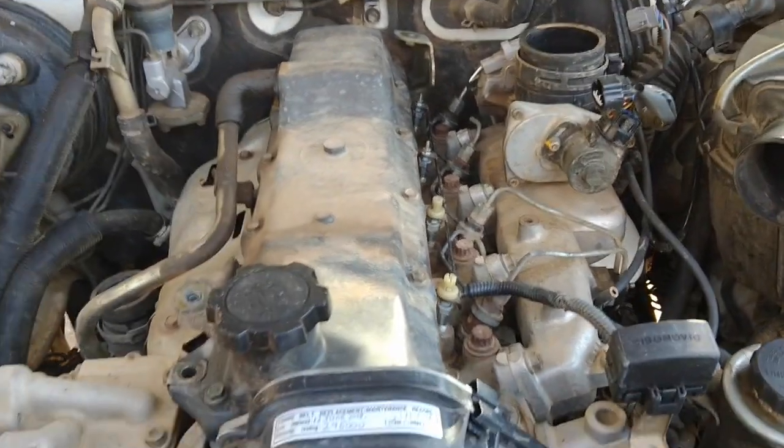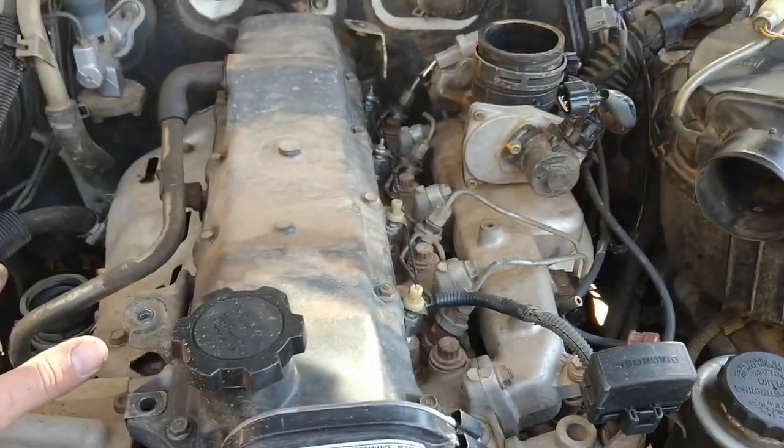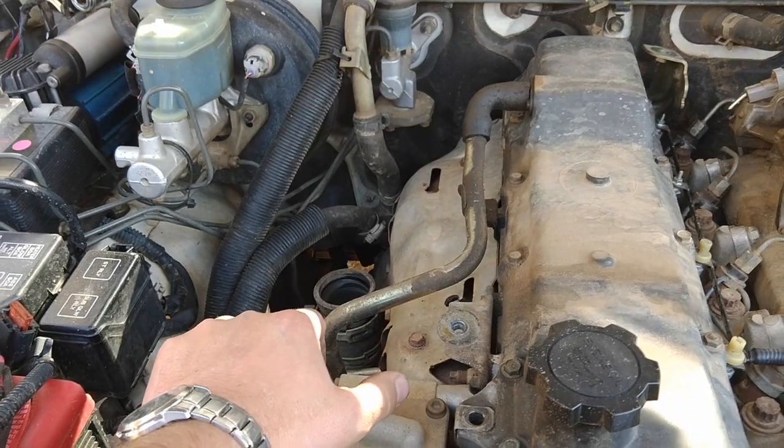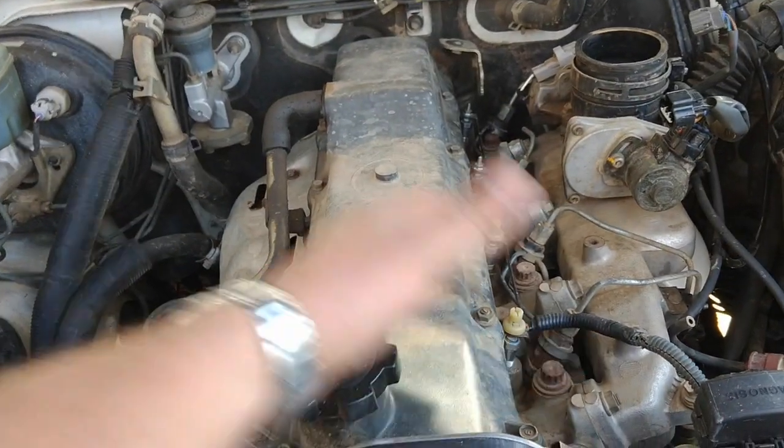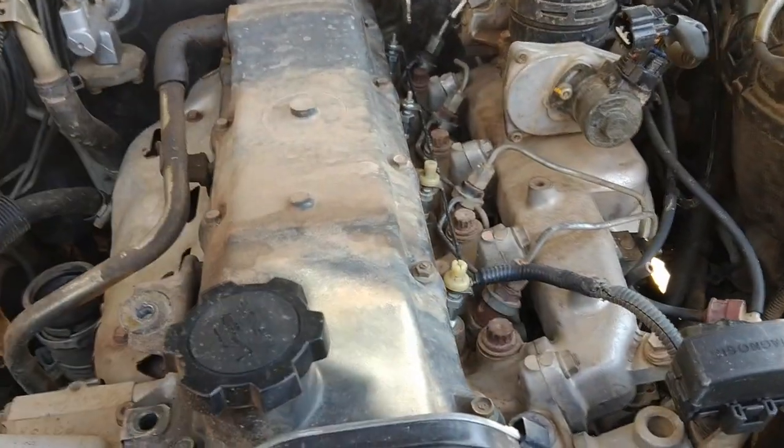It's a similar start, so you've got to get the intake pipe from your airbox to the turbo off, and then you want to take your intercooler off — there's a bolt in the front of the intercooler, one on the back — undo your clamps.